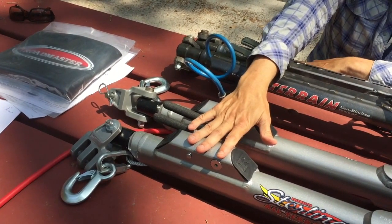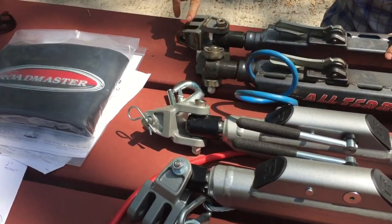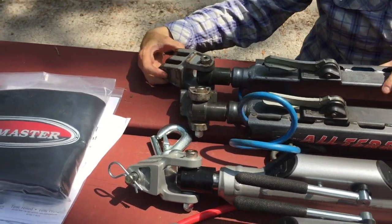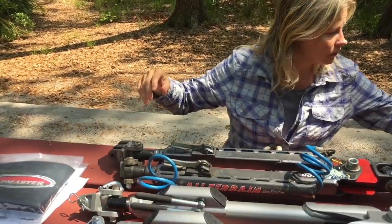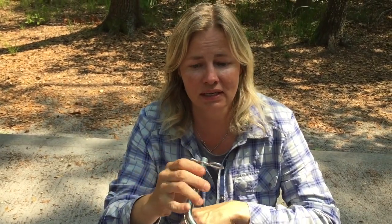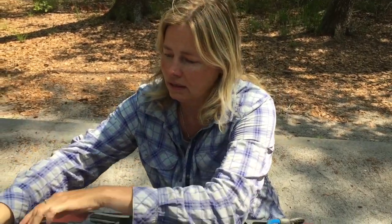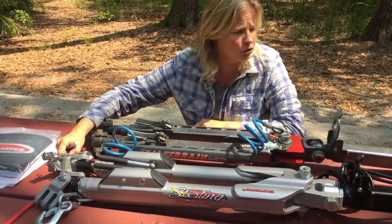The old one worked great so I'm absolutely sure the new one will too. As noted during unboxing, we have Blue Ox ends on the bar rather than Roadmaster ends, because we have a Blue Ox base plate on our car. The standard pin that comes with these ends can easily be pulled out by someone, so after our accident we switched to locking pins instead — and those locking pins are what we'll be using at both ends of the tow bar.